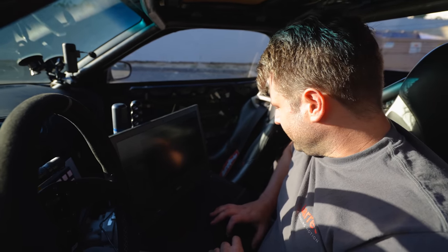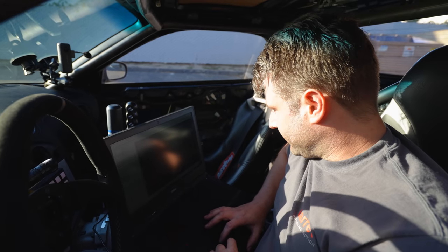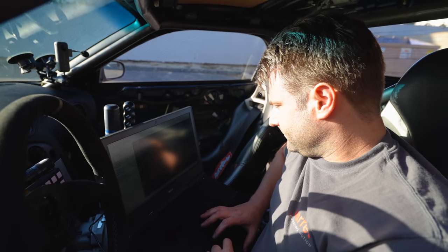It seemed like it did the same thing. Oh, interesting. Did a different thing. The fronts both locked up before the rears. So it has to be asphalt, right? It could have been that. Well, we won't make any adjustments or try to bleed the system yet because both of the... Oh, you know what? Sorry. Both of the rears locked up again. Okay, so that means that road is just slipperier on the left side.